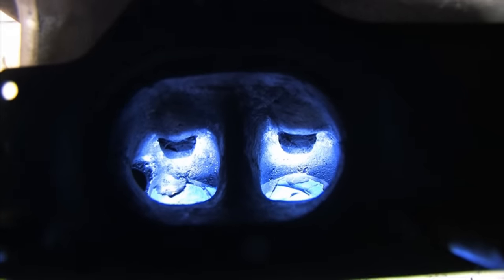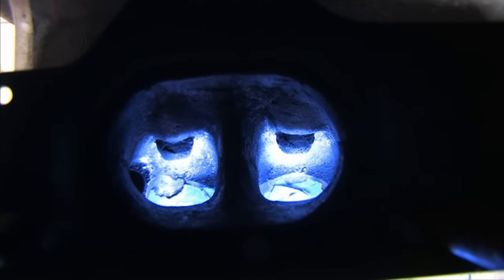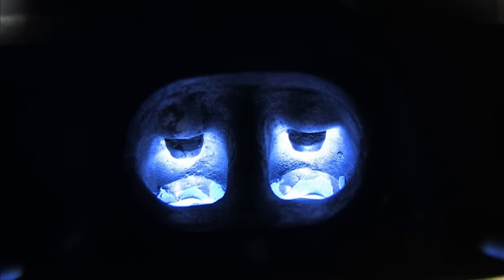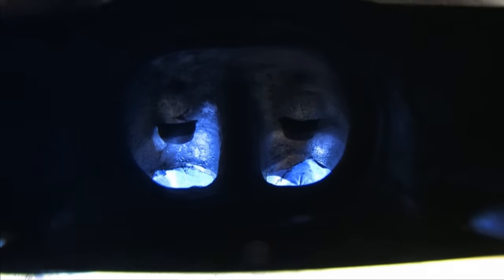Aside from the obvious contrast of what we've been working on for the past 16 hours, what's different here is that the ports are narrower and tighter. The divider is monstrous. On the 1.6 liter non-turbo Elantra head, it's as if there's a thumb right in the middle of every port, but due to the short length of the exhaust runners, they're really easy to work with. These ports are still loaded full of carbon that didn't wash out with the mineral spirits, and it actually helps us see what we're removing right now.